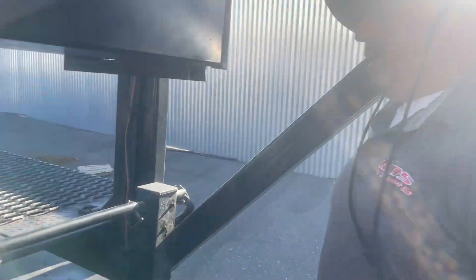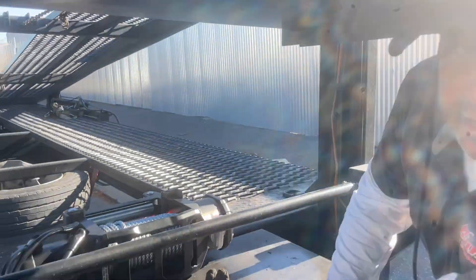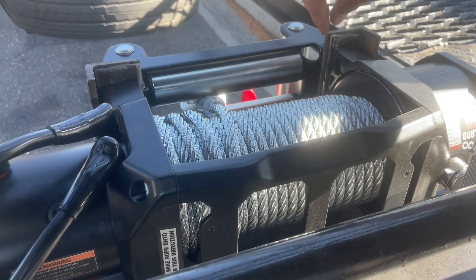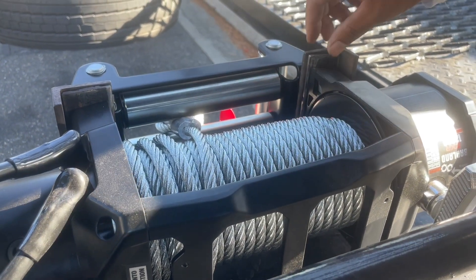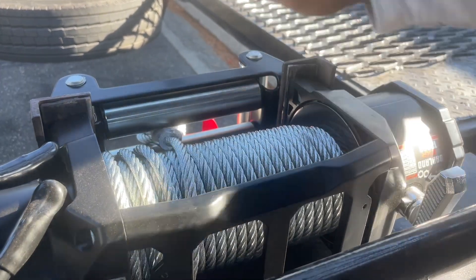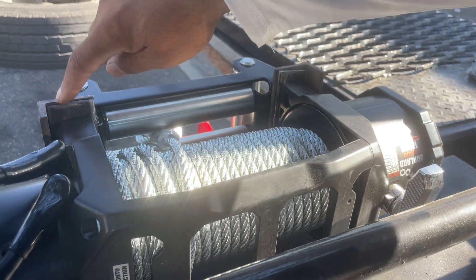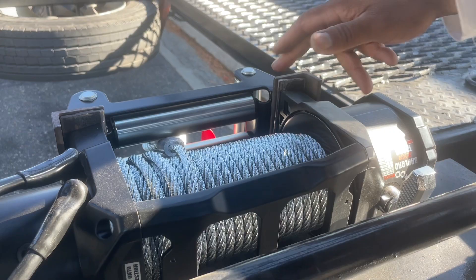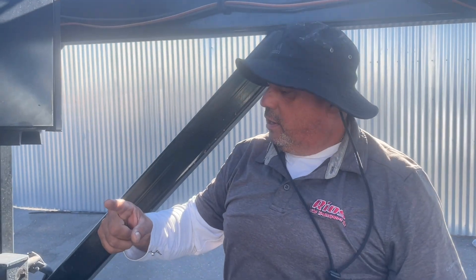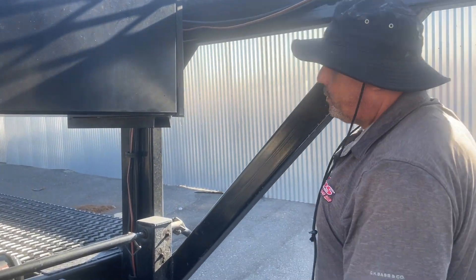Last time I was forcing it and I kind of bent the brackets a little bit. Speaking of the brackets — the steel brackets on this — check this out, guys. I reinforced it. I ran a thick plate, probably about 1/8 inch thick, so I kind of doubled up on it. When I'm pulling the cars in, this bracket right here is not going to bend anymore. I ran another thick steel plate right here — it's probably over a foot long — right down there, so that'll prevent that bracket from bending.